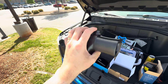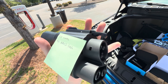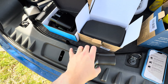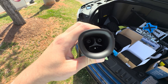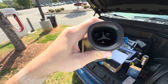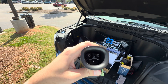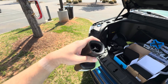The Yomile adapter was $130 — the most expensive of the Amazon adapters — and has glaring issues. The S3 CCS latch works, which is pretty basic. However, it has no latch on the NACS side at all. That means while charging, someone could trip on the cable, a kid could pull it out, and you're entirely dependent on the pin lengths being short enough to disconnect communication pins before DC pins, and the system reacting fast enough to prevent arc flash. You don't want to rely solely on those passive safety measures.